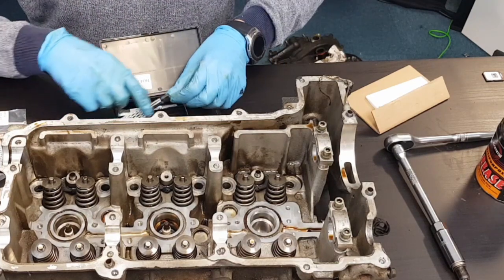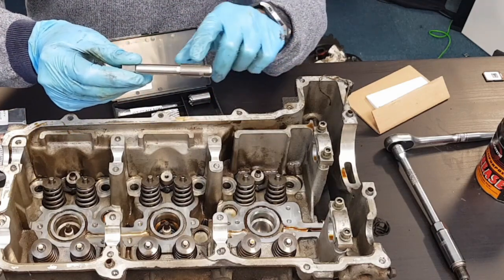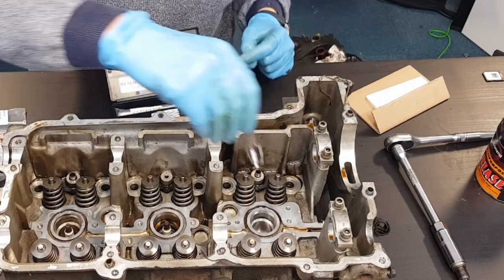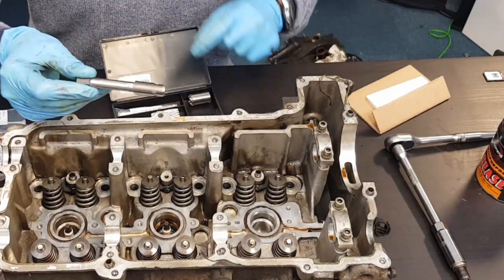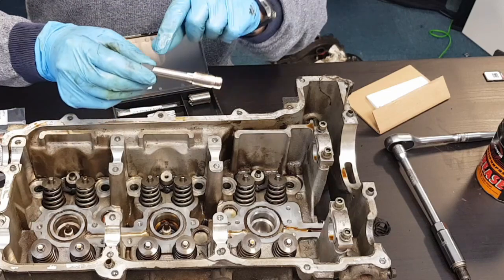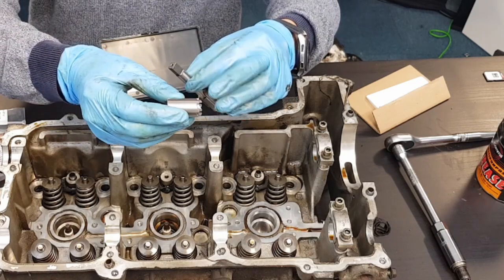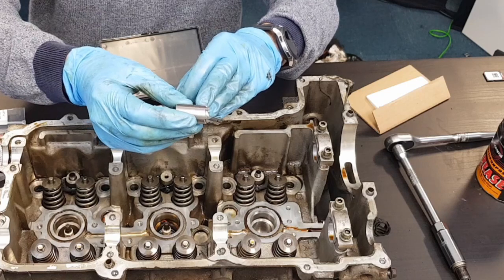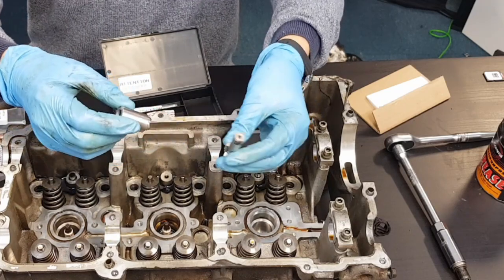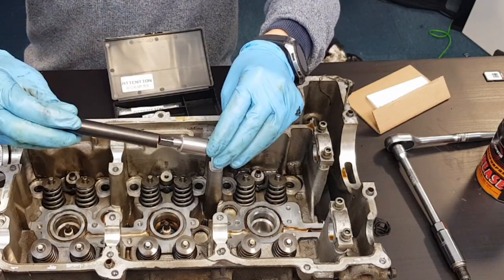The way the system works: firstly there is a combined tap and cutter — this has a spark plug thread, then a larger diameter thread for the insert, and then a cutter. The first job is that it will screw into the spark plug hole, driven by a standard tap wrench. Once that is in, a seat cutter goes in — this will cut a seat for the end of the insert and also cut a new seat for the spark plug, ensuring it is absolutely straight with respect to the hole. That seat cutter slides on and is driven by this tool here.